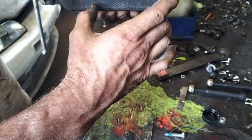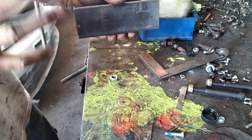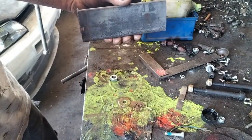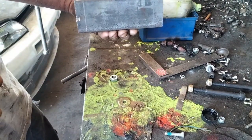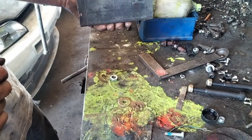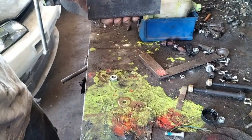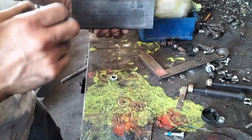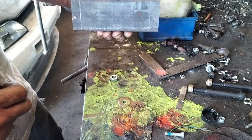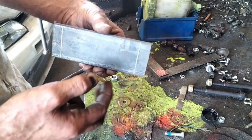I'll try to leave the relief as low as possible to allow some room to mount the engine mount off of that. I don't know exactly how the engine is going to fit until I get it in the car. The gearbox crossmember hasn't arrived just yet - hopefully it'll turn up today. So I'll mark that now, center punch it, drill it, and continue on. I'll speed you up for that because you probably know what I'm going to do.